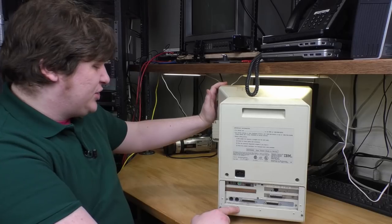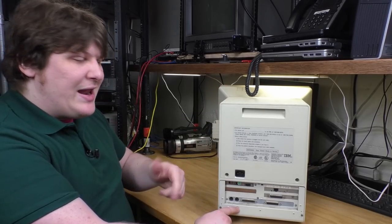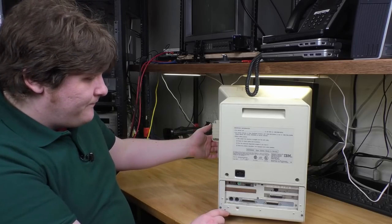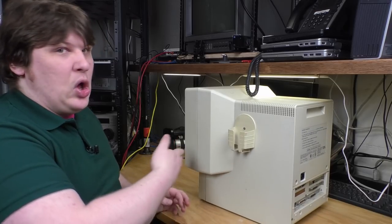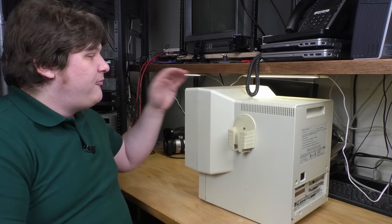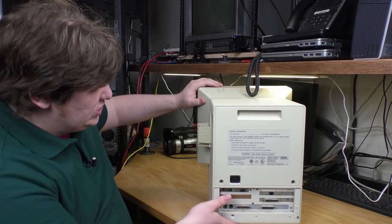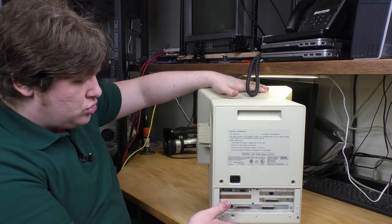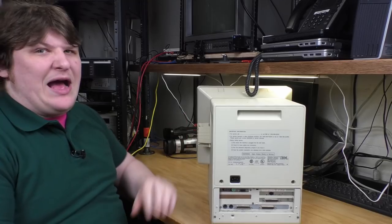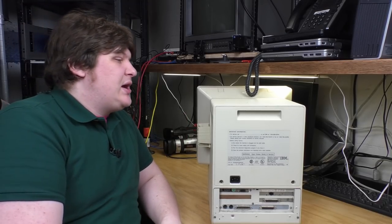Maybe it will, but I'm picturing the hard drive being mounted all the way up here in the front. In addition to that, I've got to pull the floppy drive, which is mounted all the way up in the front. Well, after that comes out, it kind of looks like the whole chassis's got to come off. Not looking forward to that, but hopefully, if I'm lucky, I see two screws here, or covers for two screws. I'm guessing it's just those two. And then maybe these ones, and I'm guessing the back will come right off. I'll have to worry about the CRT, of course, but oh well.